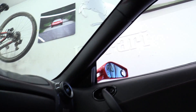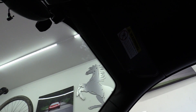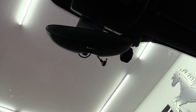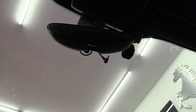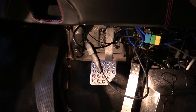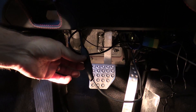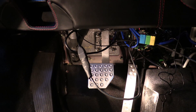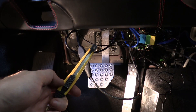You can see there's the new wire — I have it running up the A-pillar and up into the headliner, popping out at the rear view mirror, so it will be pretty easy to install from this point. There's the old wire, heat-shrunk onto the USB connector, so I'm going to have to use a razor blade and cut it off.